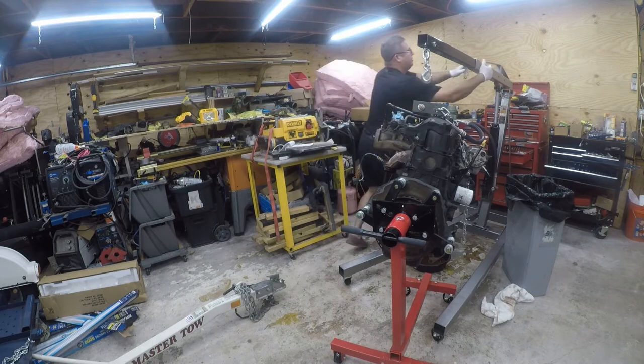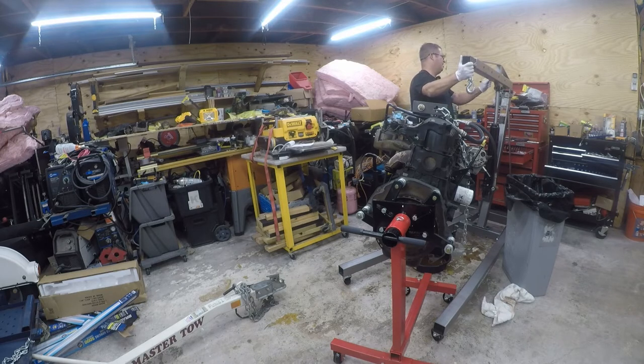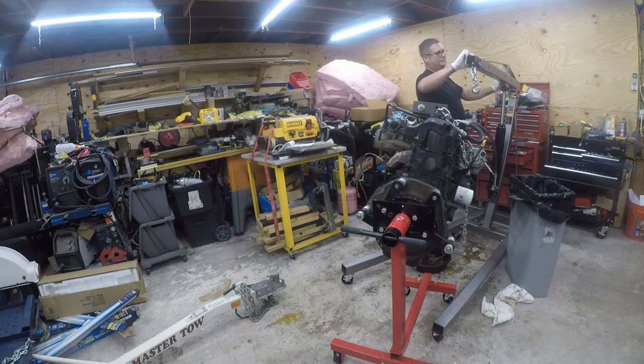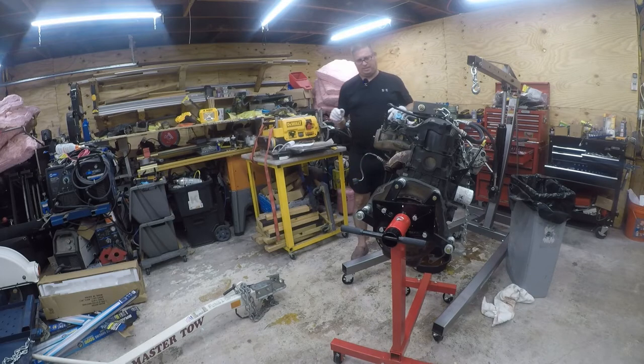All right. So I don't know why they switched to this bolt. I really don't like the bolts on here as compared to the pins on the smaller one. This bolt doesn't carry any load. In fact, it's a worse setup because the pin was tapered. So we will be making a tapered pin for this or buying one. The idea of making one sounds romantic, at least if you love tools as much as I love them. And I don't mean that in a twisted way, you sick puppies.